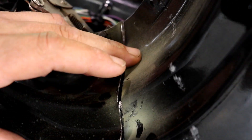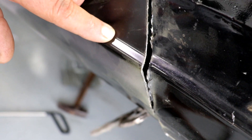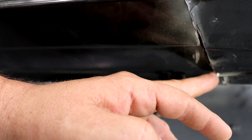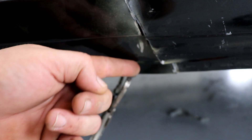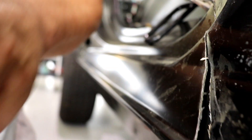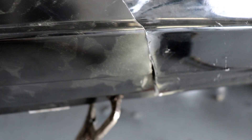Check out our fit — we're pretty good here but then it falls off significantly right here. Our new panel is lined up all this way and then it falls off right here. This needs to come out, but this right here needs to go in. You can see that right here I have a huge gap. Same thing on the other side — we're way off. So we need to bring this up and bring this out, massage it a little bit. I'm going to bring this point out this way and up, but I'm going to take this panel off when I do it.